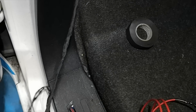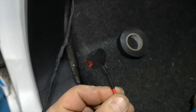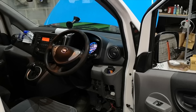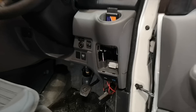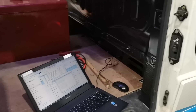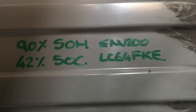Underneath here I've soldered and heat-shrunk everything. This bit goes into the CANbridge; this is our earth pin, and this is our 12-volt 10-amp pickup that goes into the fuse board. So we're going to get that wired in now, flash some software, and then change the battery. You can see the CANbridge hanging down and the wiring in front of the pedal box — Matt's just got the laptop and he's running some software off it which seems to be working, then we'll rewrite that software and rip the battery out.